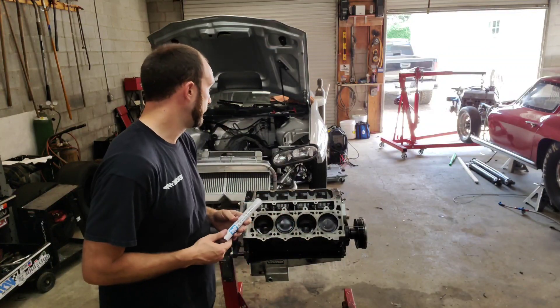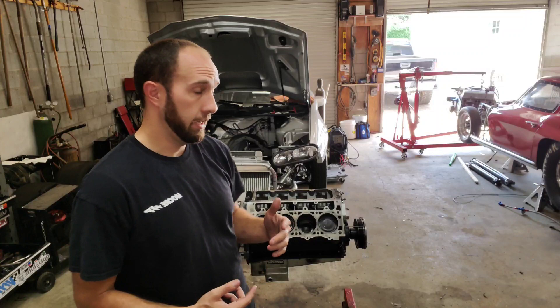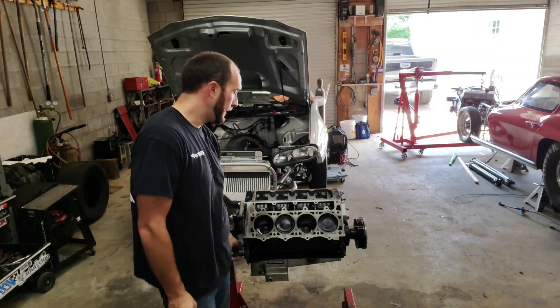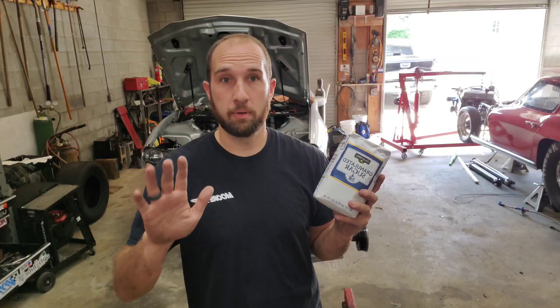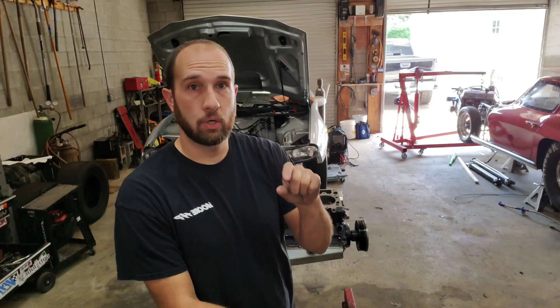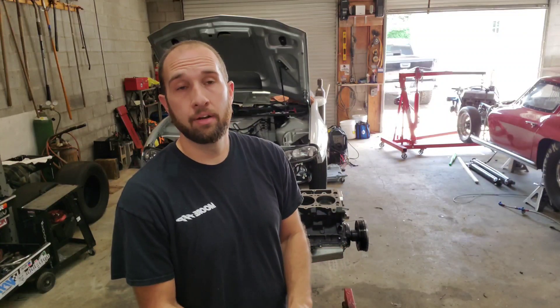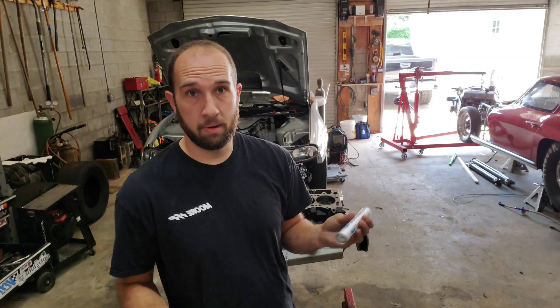We're going to give this stuff a shot and I'll show you — I've already done one side. I've leveled the block up so the surface is flat, and then I'm using sugar. I know it's crazy, don't judge me, but it works. I'm filling up all the water passages in the block with sugar — that's really just a filler to take up space. I fill up the entire block leaving about a half inch from the deck surface, packing it down, then come back and put the epoxy in each individual water passage on top of that sugar. The sugar is just acting as a backer to keep the epoxy in there until it sets up.